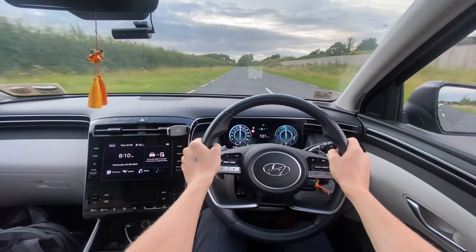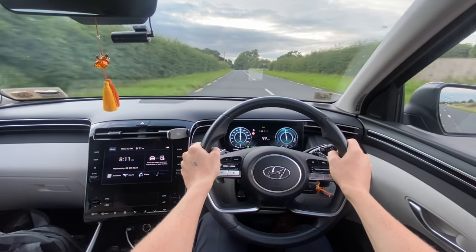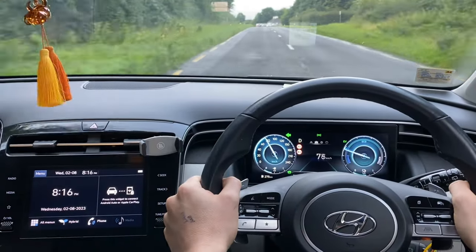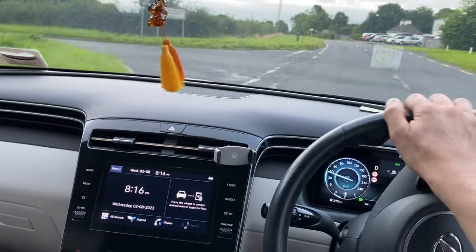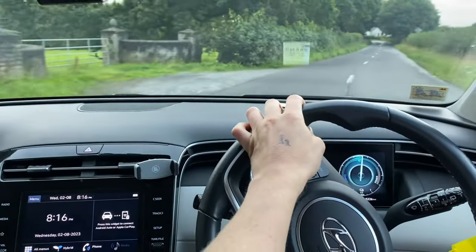For anyone wondering why the light is coming on, the main reason is your driving style just hasn't allowed the car the opportunity to clear out the particulate filter — and it's not a problem, you just need to manage the situation. On the diesel one, when the light is on consistently, you're meant to get to over 60 kilometers per hour, drive for 25 minutes, and keep the engine revolutions between 1500 and 2500 rpm until the light extinguishes. Last time I did this it took seven minutes, so the 25 minutes is a big estimate — it'll probably be 10–15 minutes.